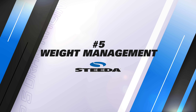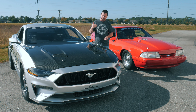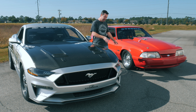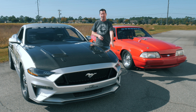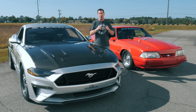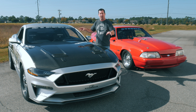Here's the last step — step five for getting the most out of your car going down the drag strip. We talked about the driver mod, the drag pack, suspension, and added some horsepower, but we want to go a little faster. Weight management. We got to try and get some weight out of the car. At Steeda we always say weight is the enemy of performance. You always see lightweight wheels on drag cars — you're going to save 50 to 60 pounds. Billet Specialties hooked us up with a sweet set of wheels for the Silver Bullet. Not only do they look good, they perform even better going down the track. Then look at the brakes — Bear has an awesome set of brakes for these S550s that saves over 100 pounds. That's right — 100 pounds off this car just by changing the brakes.